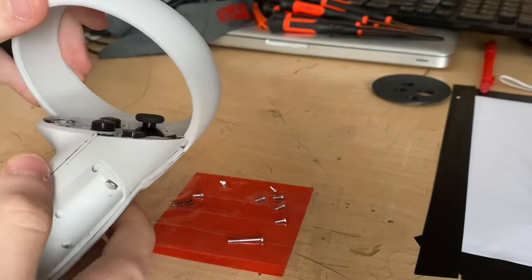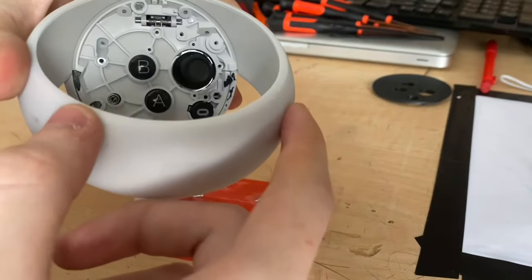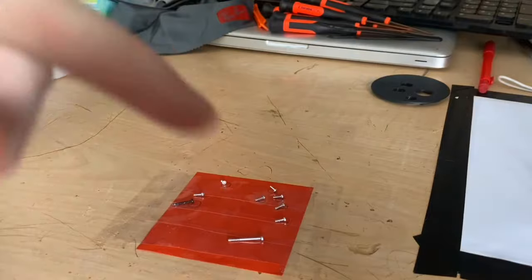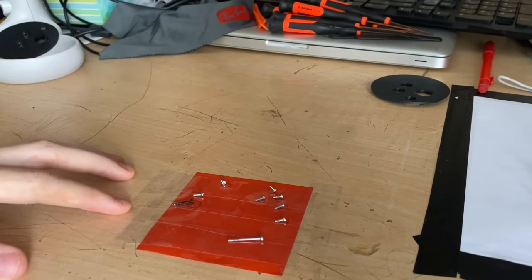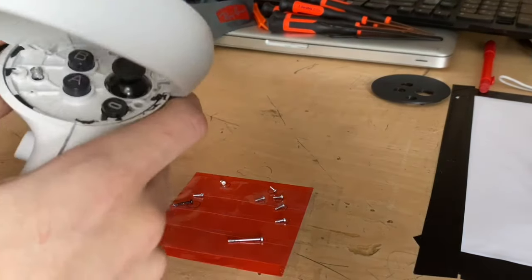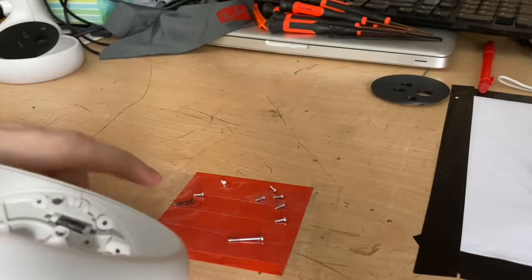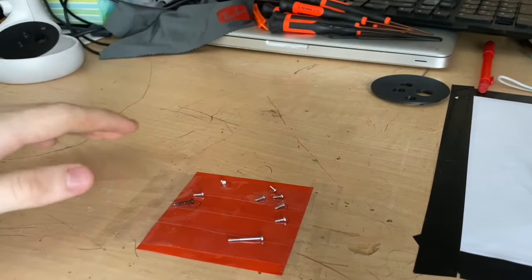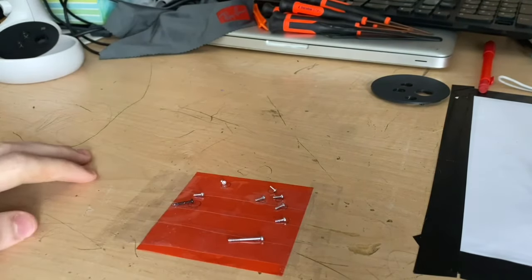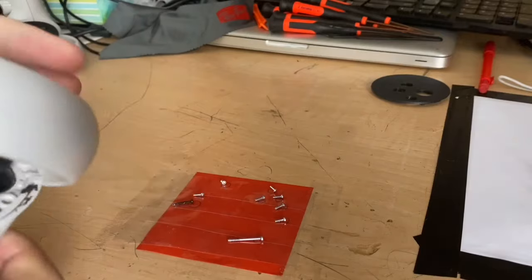After removing the cover, there are nine extra screws beneath it that you'll need to remove. You're going to want to keep track of where all those screws go. It looks like there are at maximum four different types — two screws that hold the ring in place, a couple of others, and two somewhat longer screws. I just drew a couple circles on a post-it note and used double-sided tape to keep everything in place, and also took a photo so I knew where the screws would go.